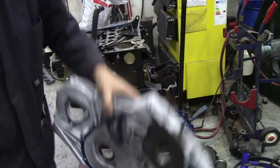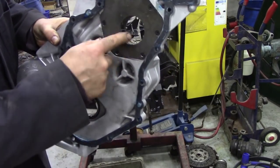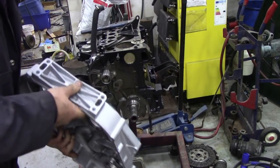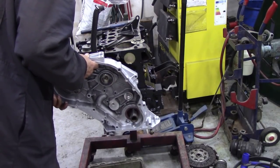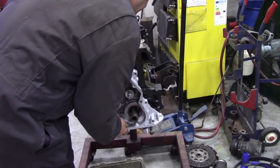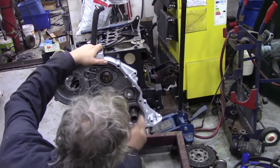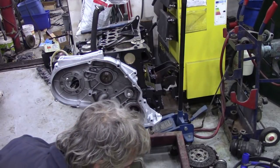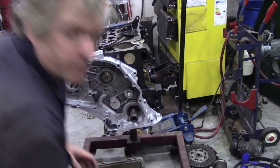Two flats on the crank should correspond with the two flats here, so we've got to put those in a vertical plane for this cover. This is upside down at the moment, but you couldn't see it the other way around. So let's apply that, turn this, and you should see that it doesn't line up quite right on the bump. I'm going to have to just turn the crank just a hair to get this cover on.